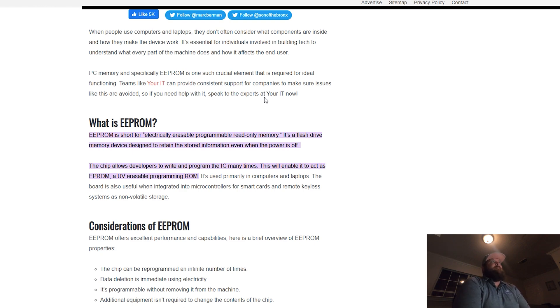That is why most dealerships and a lot of body shops will tell you if the module has a hard code it needs to be replaced, which is very expensive. That's just a cash grab from the manufacturer — they say that in the guides because they want you to pay out a couple thousand dollars for an SRS module. The reality is it's one chip on the circuit board of that computer called an EEPROM that's holding the data. They're re-writable over and over again. All you've got to do is communicate to that chip, erase it, and put back what was on there originally.